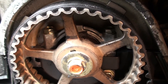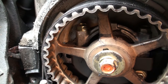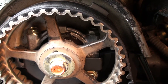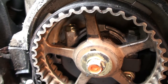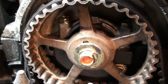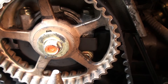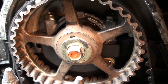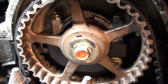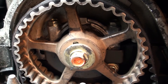Now as I start breaking it down — the car stopped running — you can actually see the right side of the camshaft is up and the left side is down. It looks to be about two teeth off, and that's enough to send some weird signals back and forth between the cam sensor and the crank sensor. We're already in here doing a timing belt anyway, but I'm pretty sure that's a good reason why this would have shut the car down.